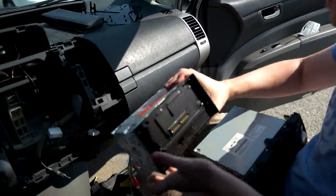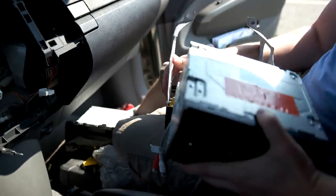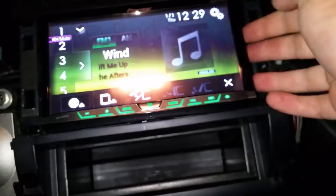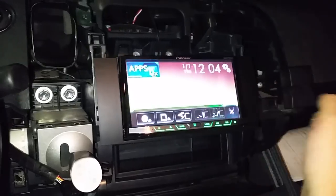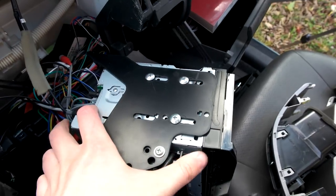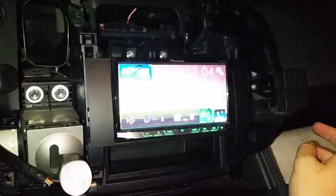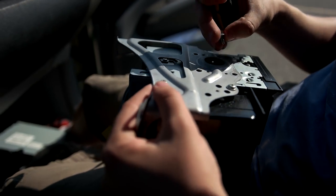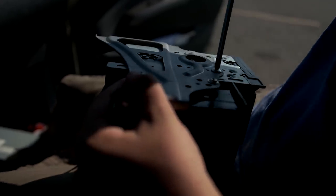So this is the new head unit. I took the screen off so that I don't damage it. It looks like we just fit this right into there. After I installed the OEM metal brackets, however, I found that the screen didn't fit right behind the new bezel, and it got stuck when I tried to eject the screen. So instead I decided to try the plastic brackets that came with the kit — this time it fit much better. These are adjustable, and I found after some trial and error that sliding them a bit backwards gave the stereo the best fit. The OEM screws didn't fit in my particular head unit, so I used the screws that came with it. I only have six of them, but that should be enough to hold it in place.